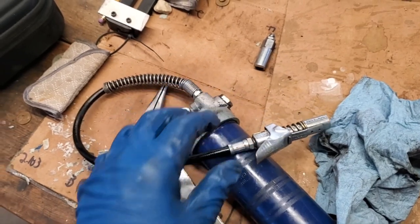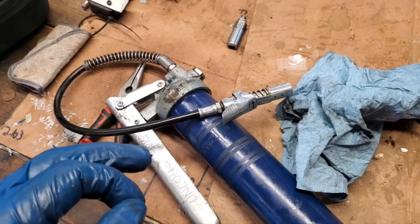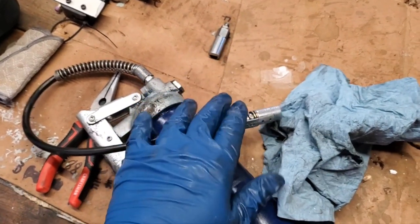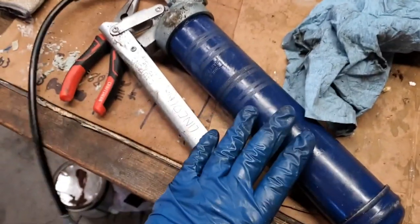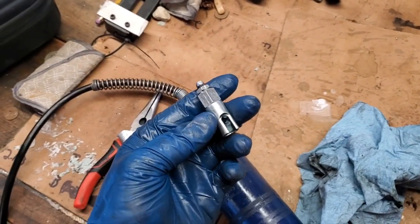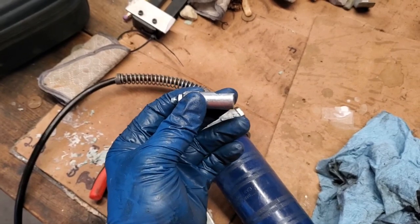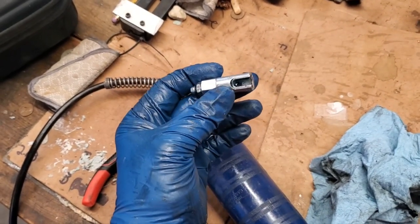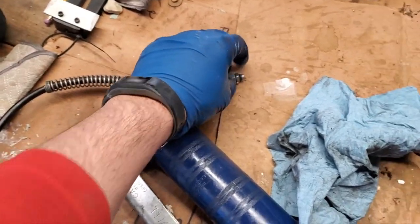come off. I've used this on some of my tractors where grease zerks have been on there for 70 years and are all packed full of all kinds of stuff. This thing will get grease in there. And it's real nice too, because once this is clamped on, you can put both hands on your grease gun. They also make a 90 degree fitting, where you clamp the Lock and Lube onto this. For those grease zerks that you can't really get to straight up and down, this slides in there and locks on easily too, and I'm able to grease everything with this bad boy.